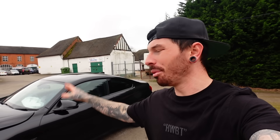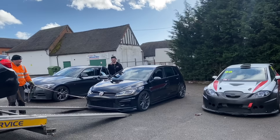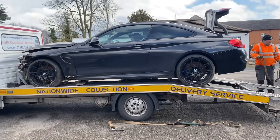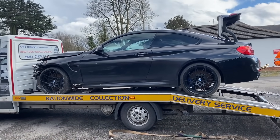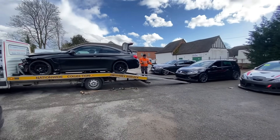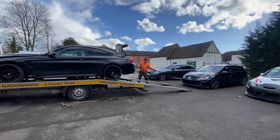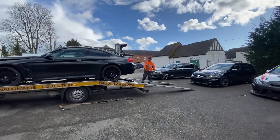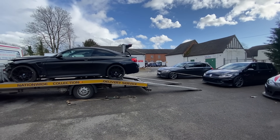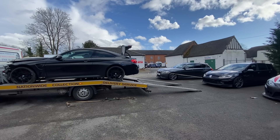So we're going to go through the damage - what adds up, what doesn't add up, what I think's happened. But for now we've got to get this thing moved. When these BMWs are crashed and the airbags are deployed, it activates almost like a kill switch on the battery. You can bypass this on the battery, but I didn't want to start the car because it looked like the oil cooler was off - so possibly no oil in the car, and also no coolant in there as well.